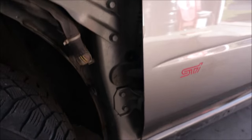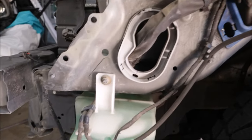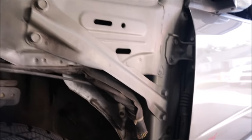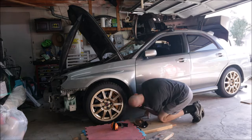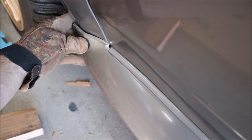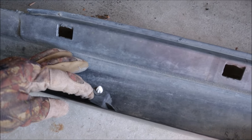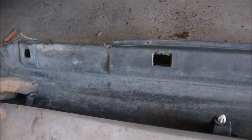On the leading edge of this door there are some chips that would kind of explain the fender getting smooshed and maybe going into the door, but under here I don't see anything that would show the factory spot welds have been drilled out, removed, or that anything has ever been pulled. So that's a good thing. It looks like the side skirt is going to fit much better now — once we align the fender it will flush up a little better. However, I do need to work on these tabs because this one is broken and this one is really broken, so I think we'll super glue it in place and maybe put a little two-part epoxy to strengthen them a bit. I think we're making some progress.